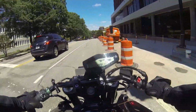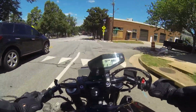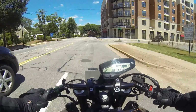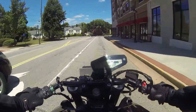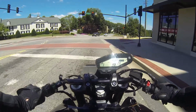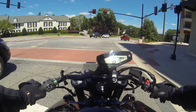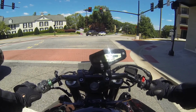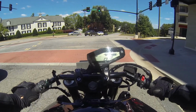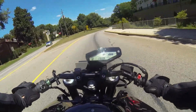So for those of you who are looking to do anything beyond just a regular slip-on system, yes, do it 100%. If you're just going to put in a slip-on system and you get some experience with that back popping sound or any kind of weird gurgling, yes, do it for sure. If you put on a slip-on and it was perfectly tuned and perfectly fit for that year, make, and model, and you don't get any crazy stuff, you can do without it. Obviously, the engineers have to put it in for emission standards and performance standards as well. But the bike runs well without them, with the correct block-off stuff installed, and obviously you get the added benefit of having a true mixture.